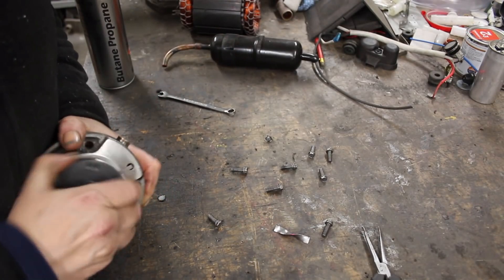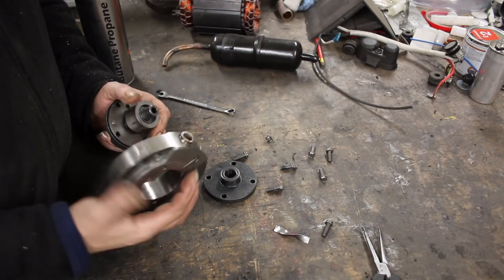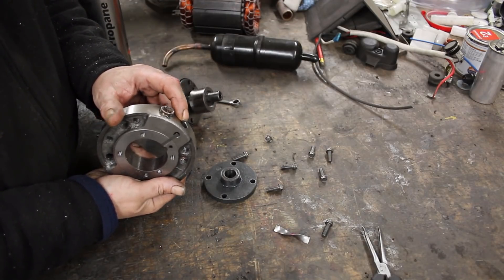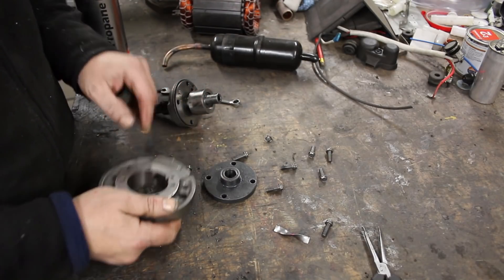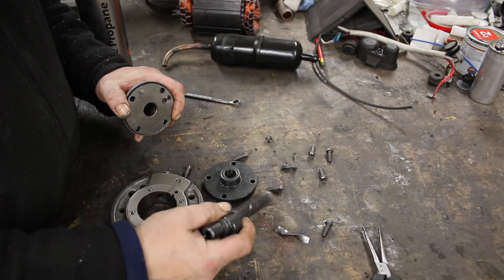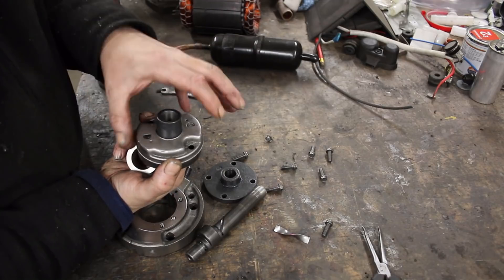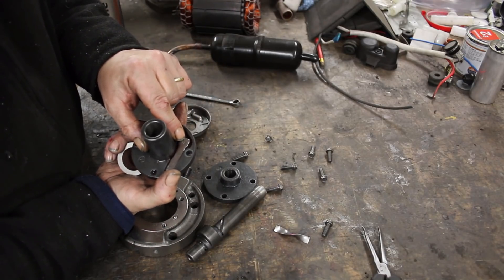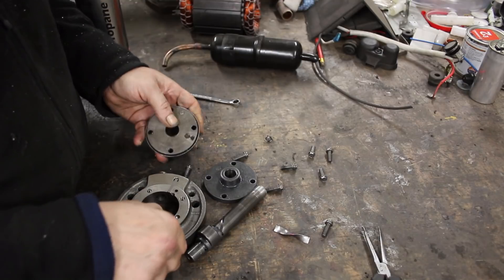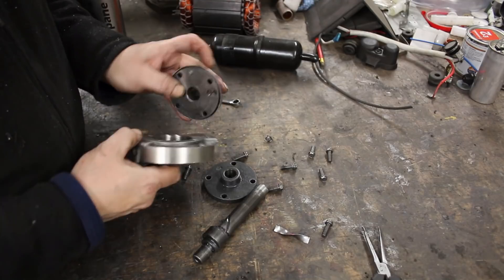So I've disassembled the compressor — there's the cover plate. That's the cover plate and you can see the valve chamber here; it's just a circle, it's got one outlet there, and another hole here where there's a spring operating that piece of steel which presses against that. That comes off when we're on a cam, and then that obviously goes to the motor. This bit is the inlet valve — we've got a couple of little cuts in there that allow the gas in, and then we've got an entry valve right there so the gas can come in but gets closed when it comes around.